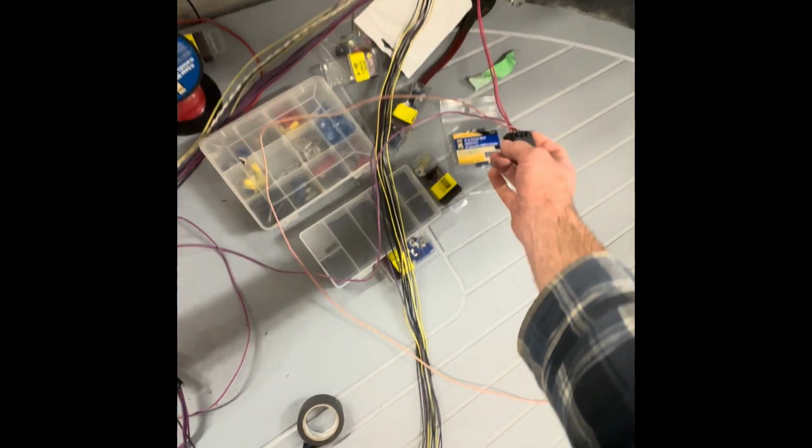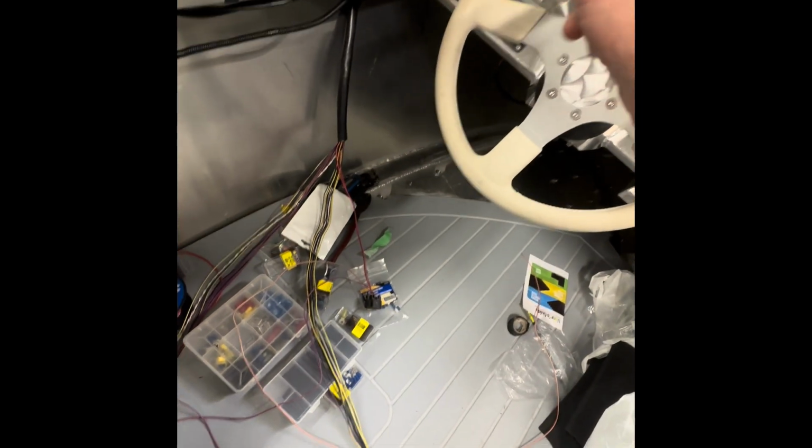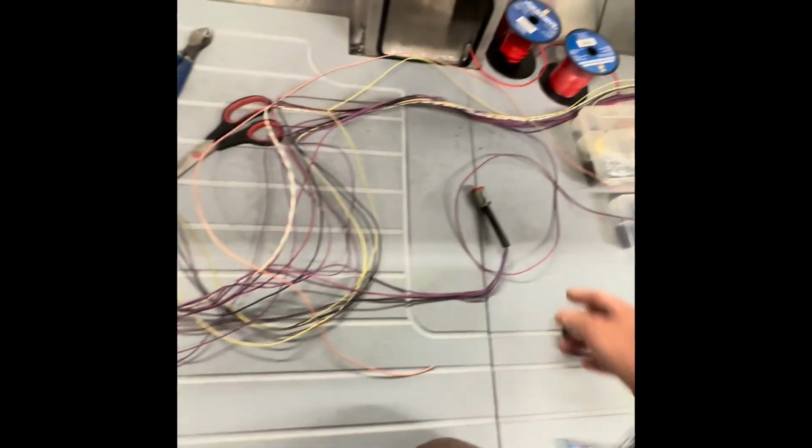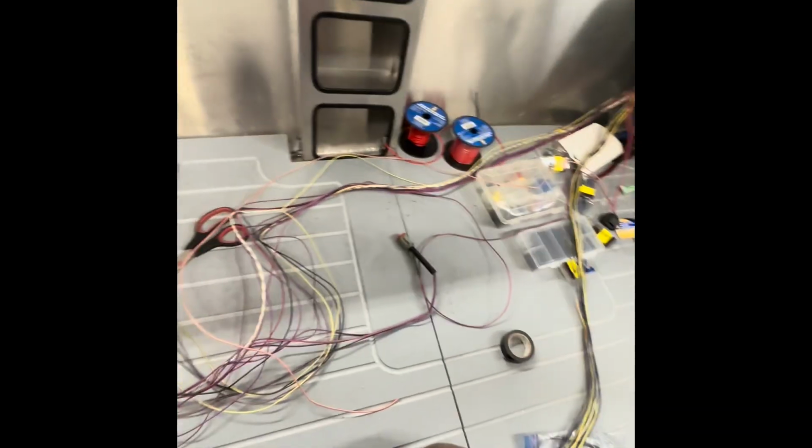She's coming together. All right, quick update. Splicing the Sea-Doo harness. There's many joints where, say, for instance, the fuel harness, two wires come from the cluster, then one wire goes to this harness off the ECU, then the other wire goes back to the fuses. So all the different sections of harness like this and this, everything where they branch off and meet, you can cut all that off, because this way I only have to extend two wires all the way back to that corner.